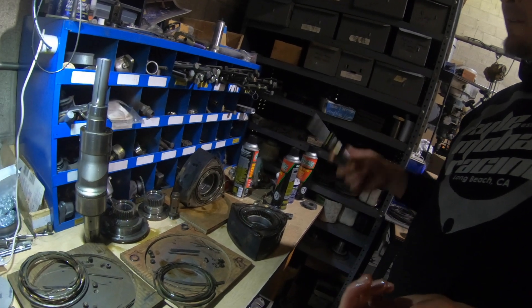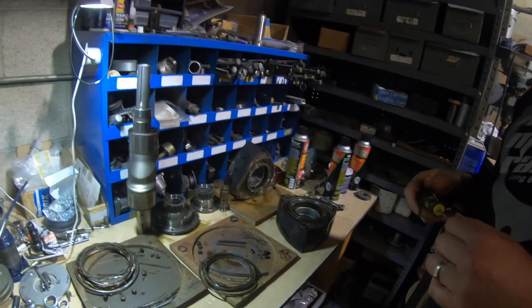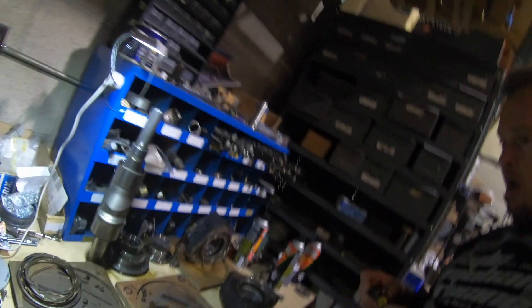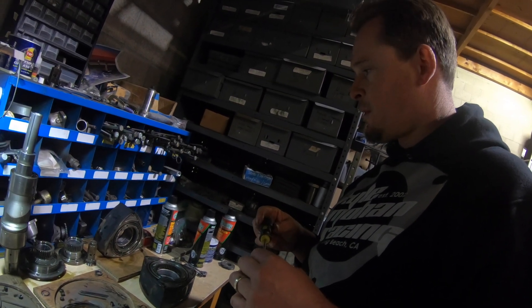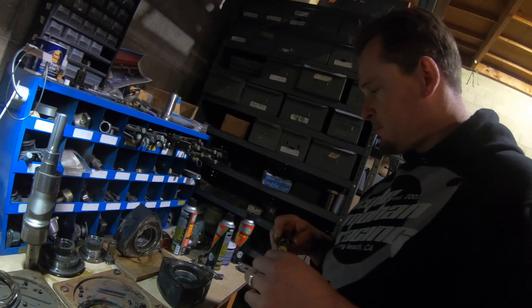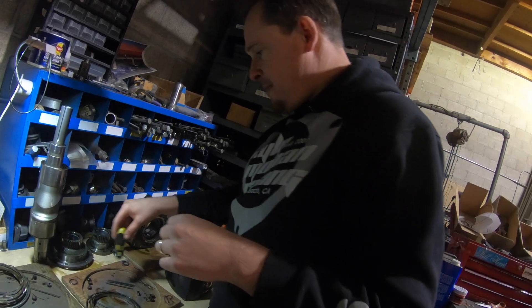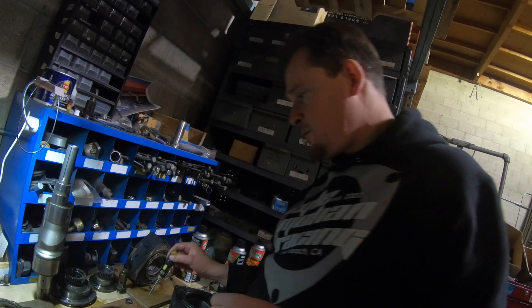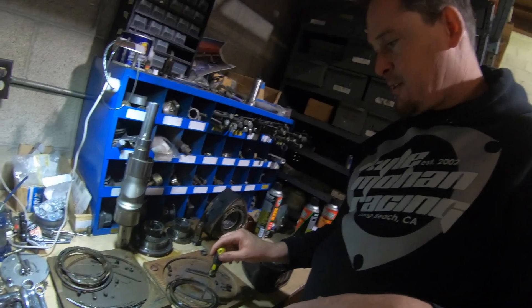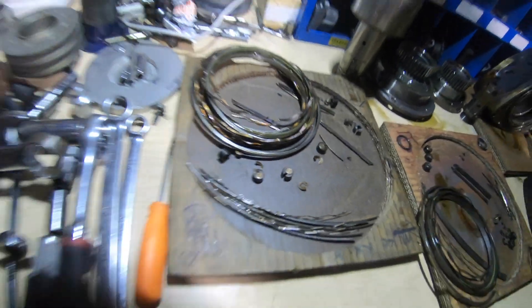The good news is bearings look great. WPC-treated shaft looks beautiful. Apex seals and most of the springs — everything looks pretty usable. It's going to be a matter of checking the tolerances on the side seals and double-checking to make sure all of those are sealed up good. We were probably losing some compression in there since it was so even on all sides — so it's not an apex seal issue. It's either corner seals or side seals. RX-8 corner seals really don't screw up that often — they're either in right or wrong. If you put them in upside down, it breaks the motor instantly. So that wasn't the case — it ran for 3,000 miles.